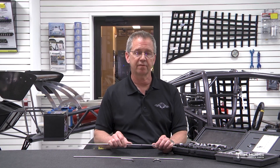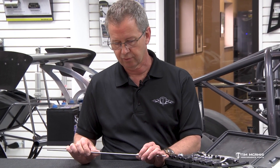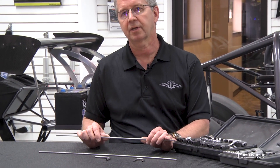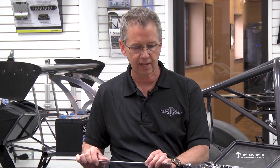But it's got a lot of advantages — not going to corrode, it's really tough. The steel lines, if they take a little hit even with a wrench or something, you can dent them. This stuff is very tough. There's a lot of differences between the two. The stiffness is one thing, but the flaring of them — there's a lot of difference in that.